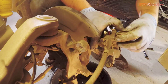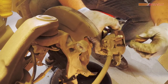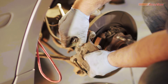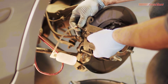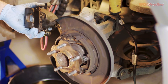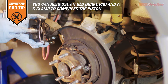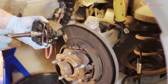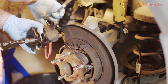Some bleeder valves may have a small dust cap to protect the valve — make sure to remove the valve cap first. Then use your 10mm socket wrench to open the bleeder valve. This is what allows the brake fluid to come out. You'll want to use a brake bleeder kit or a drain pan to catch the brake fluid. Keep the bleeder valve facing up to prevent air from getting in, and try to make sure no brake fluid gets on any painted surfaces. A caliper compression tool and an old brake pad will make life easier. You can borrow one through the free AutoZone Loan-a-Tool program. Use the caliper compression tool to compress the piston until it stops, then wait until all the fluid is done coming out. When you're finished, make sure to tighten the bleeder valve back up.